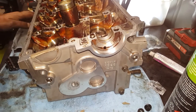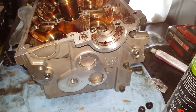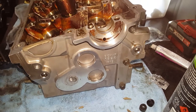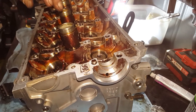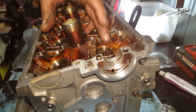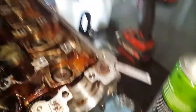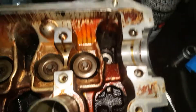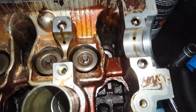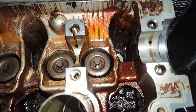So a little bit of mucking around, but all these other guys here — these three went in first go, no problems. A little bit of mucking around, but you've got the camera on there. I slipped — I don't know if you're recording it. Yep, it is on. So you can see there's a little bit of mucking around with that, but it does work. And that's all the valve stem seals and valves reseated and everything's done there now.